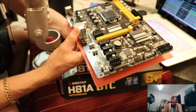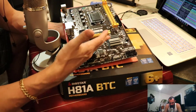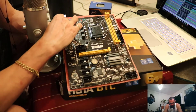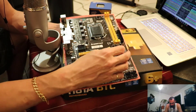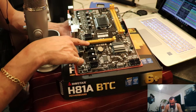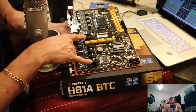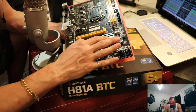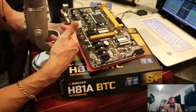Without that huge price. I'm not sure if it has AVR functions like the other one does, but it does have a four-pin connector for the board and your standard connector as well. I like that it has supplemental auxiliary power — ports one and two — for these slots to supplement your power. I still highly recommend powering your risers. Really liking this board and the Biostar logo.